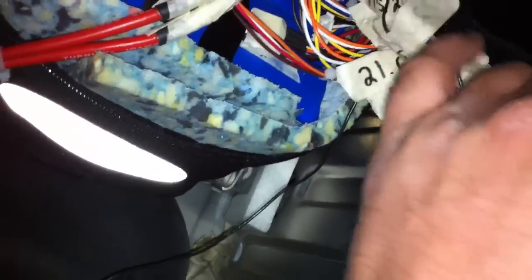Basically these wires tap into the balance leads of my LiPo cells, which are right there. These balance leads — those tabs there all across — they go to the different voltages. So you know, zero, 14 volt, I believe there was 21 volt, 21 volt, 36 volt, then there's like 50 volt — you can see it there. So basically every so many cells I tapped into it to duplicate what it was doing with the nickel metal hydride battery.